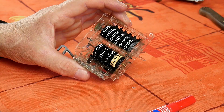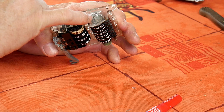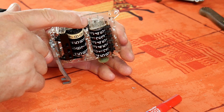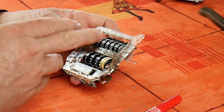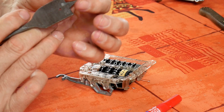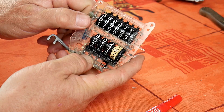I'll glue it now and mount it back. Finally some good news — it's now working perfectly! I bought some super glue and fitted it here. What I did: I pulled this, placed the super glue inside, then closed it. When closing, you don't want the glue to get stuck everywhere, so you keep turning it and turning it so the glue doesn't set between the parts. Then I used a tool with a V-shape to clean all the excess glue from the dents inside.